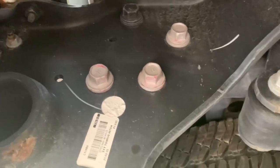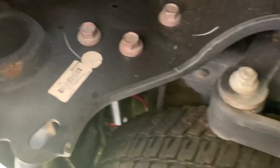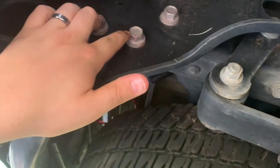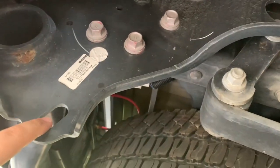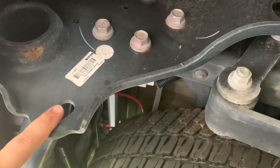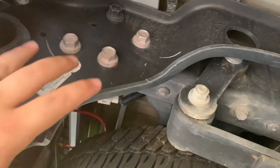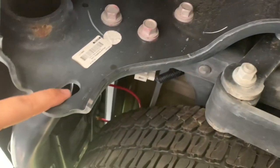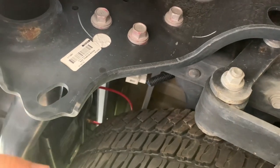So we're under the passenger side of the truck, and this is the hitch. There's the back of the truck right here. You just have these two bolts that you remove with a 19 millimeter socket. And we utilize this hole as well for the bottom of that bracket. And that's literally all you have to do — remove those two, put up your bracket, install these two, install this one with the washer on the back, and that's it.